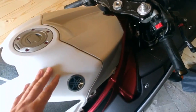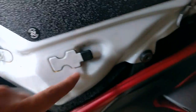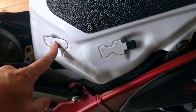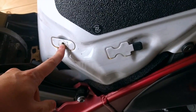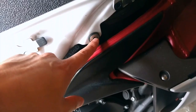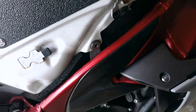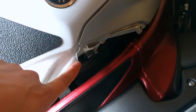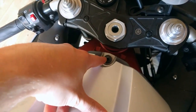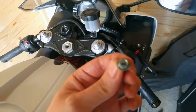You need to take the seat off because there are these fairing covers - this is the bit that goes in here, which is just on this slide-out hook but it's actually screwed into this point here, which is underneath hidden by the seat. So you've got to take that off to pull it out - one screw out and then slide it forward. You need to take this bolt out here, which is on both sides, to be able to lift the tank because it's attached to the frame there. Then there's a single screw that goes into here, and the main bolt that goes into the frame at the top. And on the underside are two 8mm bolts.